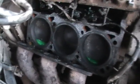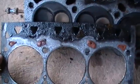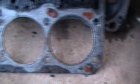Going to call it a day. One head's off — got coolant coming out of a head bolt hole, not sure if that's normal but we'll soon find out. Heads off, bit of coolant in two pots there. Can't actually see anything obviously wrong with the head gasket — it's a bit dirty and clogged up. Thought these holes weren't meant to be there, but they are. We'll see what the other side brings us.